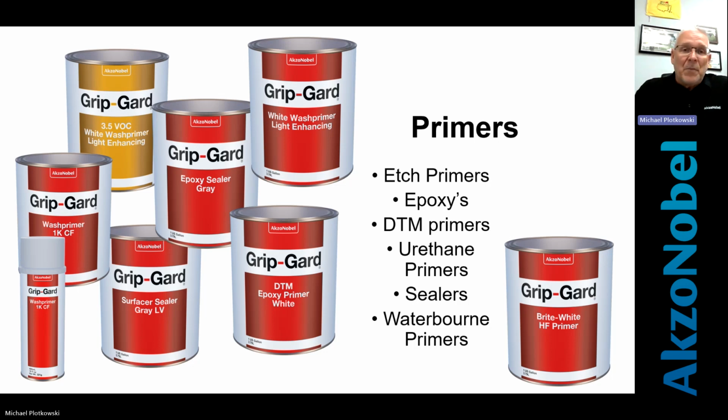Well, when I hear the word epoxy, I think of glue. Everything sticks to glue, right? If you're not prepped right and you put epoxy down, you're going to have a dirty paint job when it's done, and you can't see it. You won't see it till it's painted, especially black or a high gloss type color, which we use about 5% in our business. The rest of it's satin, but you'll still see that. Direct to metal primers, a lot of steel, a lot of poles, cabinet frames, big cabinet frames that are steel. Direct to metal primers are good in that arena.